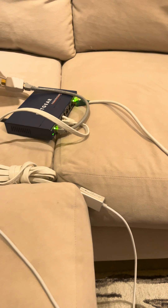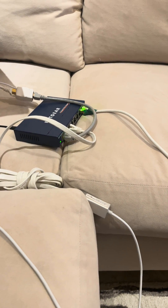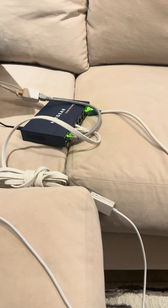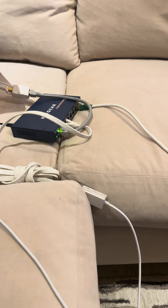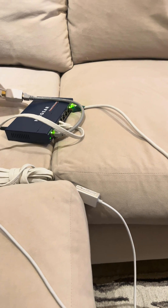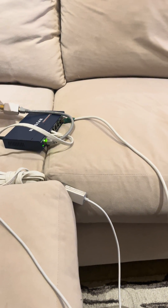All you have to do is head on over to your switch or wherever your modem is — if it's your modem, it's the same solution. Basically, you unplug it, wait 30 seconds — which is a long time when you're counting to 30 — plug it back in, and then it should be working. Basically, it's just resetting the IP address. And it works.